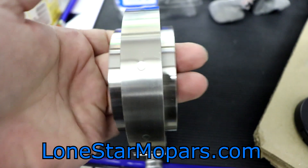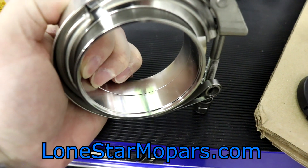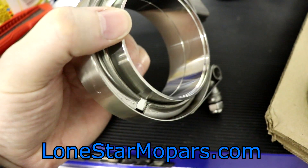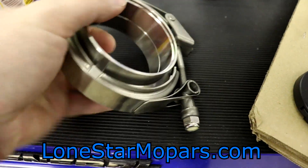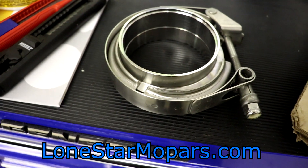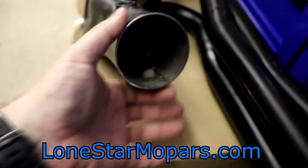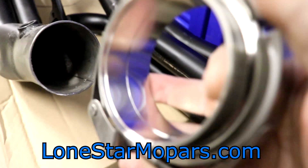Where we started the video — this is a V-band. It's going to be a simple quick-disconnect so if we need to pull the transfer case, transmission, or whatever, it's super simple and clean. V-bands use a machined lip — this welds on, that welds on, the clamp keeps them in place. If you want to take this off in two years, no problem. You're not going to have to beat it off with an air hammer.